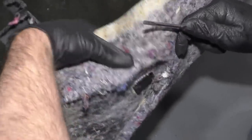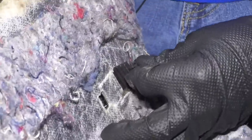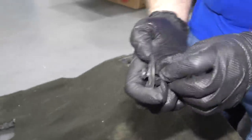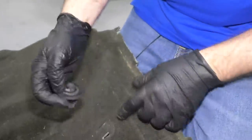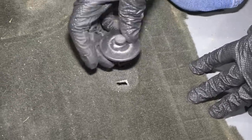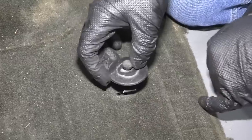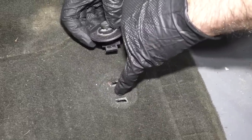To take these pins out, take a straight blade screwdriver — they're clipped in — pop that out and slide it out. When you go to install this in the new one where you made your mark, make a slice right there and then a little slice right there. Don't actually drill a hole where you made the mark; that's just where the center's going to be. Same with the other one.